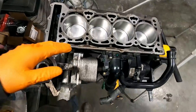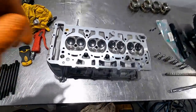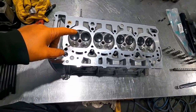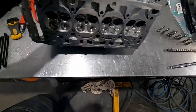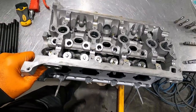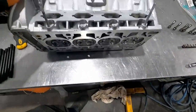The TSI engine — rods and pistons are in. We still got the oil pan and all that stuff to do, but I want to get the cylinder head on. In regards to the cylinder head, we had this thing set out with 1mm oversized intake and exhaust valves, and we went with a set of Supertech springs and retainers as well. So we'll be able to get a little bit more RPM on the thing and a little more flow.